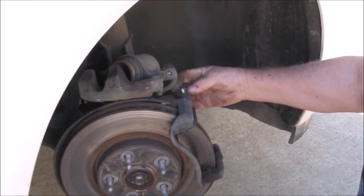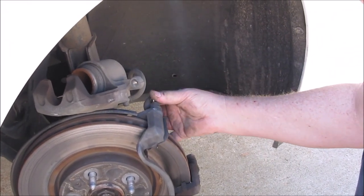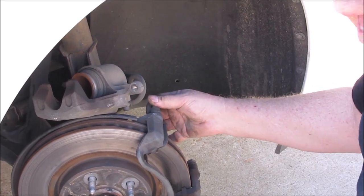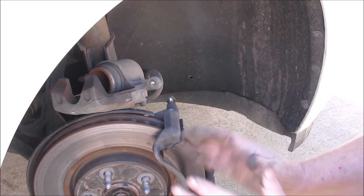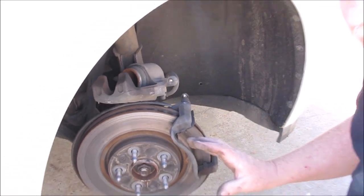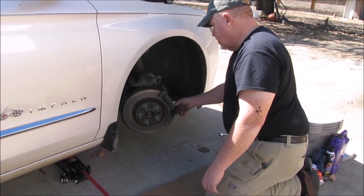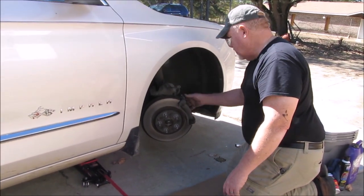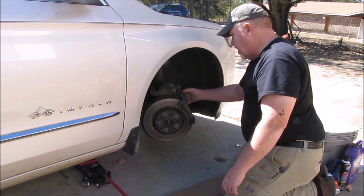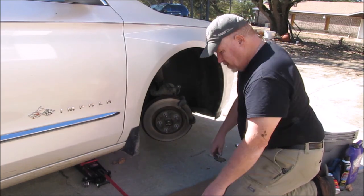This is where the screw that mounts the caliper screws into this little piece. You can see it moves in and out — that allows the caliper to slide back and forth, which is what keeps the caliper centered so you don't have uneven wear. It's a little sticky, so I'm just going to clean it and lube it up a bit. They're not terrible though — I don't think it's really a big concern.